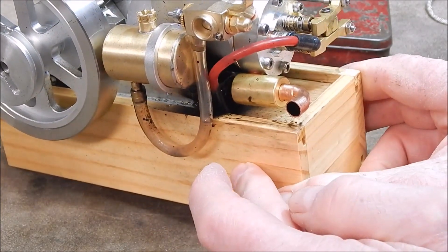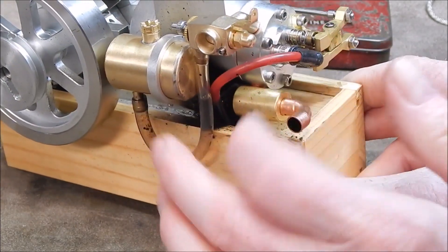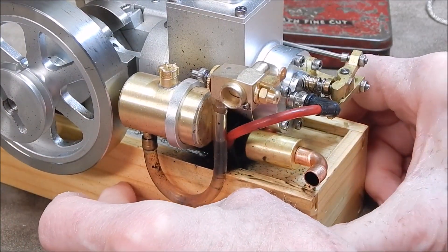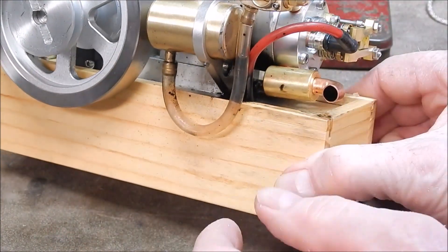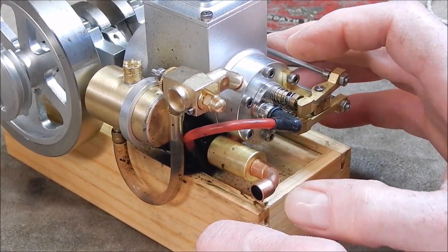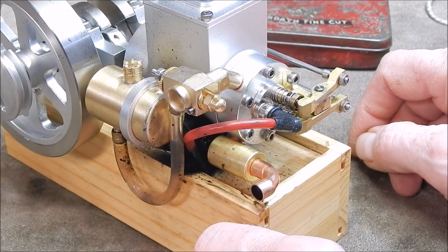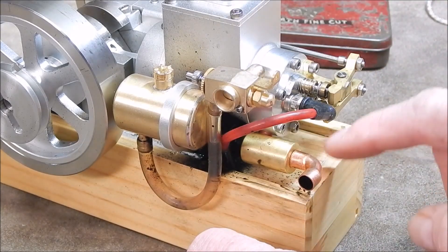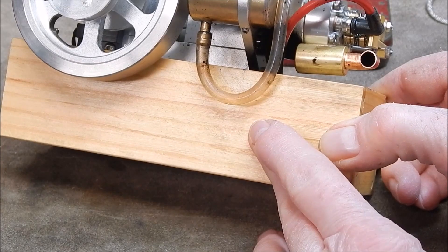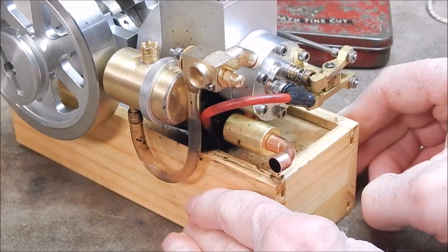The alternative is to take the fuel tank off, which wouldn't be hard, and take the motor off the box — the base — which also wouldn't be hard. But do I want to disturb the head? It's a matter of how the head's sealed and if I bugger up the gasket or the sealing o-ring or whatever they've got there — it looks like a copper gasket. Maybe the best thing would be to take the motor off the base and drop the fuel tank off, but it would still hit the base. So I'm going to have to take the head off. There's no two ways about it.